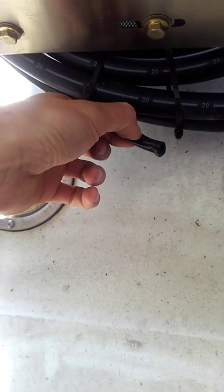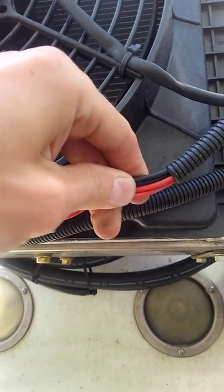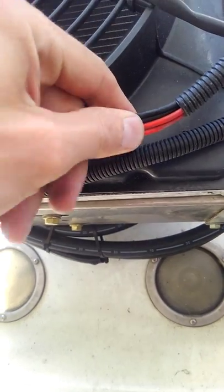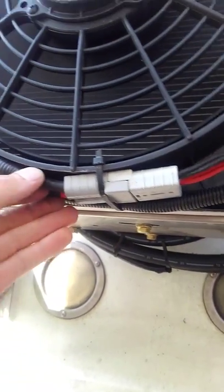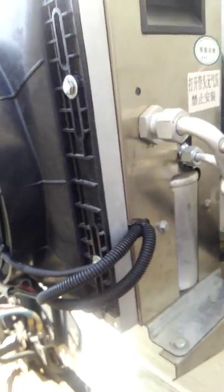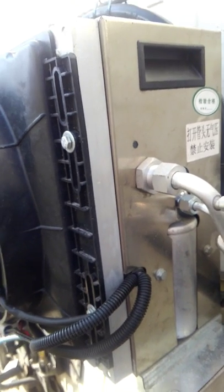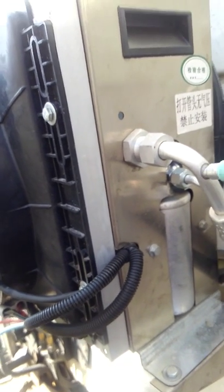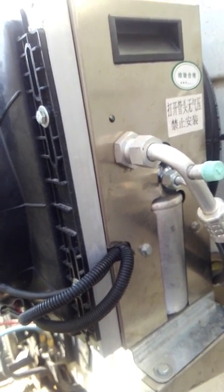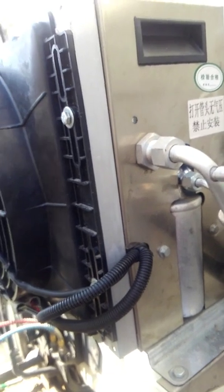You can see how much moisture the unit's pulling out — quite a bit of moisture is coming out of it. Grabbing the wires right now — they're warm but they're not hot. They probably could have used higher percent copper or a thicker wire, but it's not melting your fingers, it's definitely warm though. The fan is also variable speed — you'll hear it speed up and slow down as needed. It's very efficient. At 7,000 BTUs and 30 amps, which is around 400 watts, that equates to a 7,000 BTU air conditioner pulling only 400 watts. A regular 5,000 BTU window unit is going to pull 500 watts, so this is a 7,000 BTU pulling 400 watts — it's a very, very efficient unit.